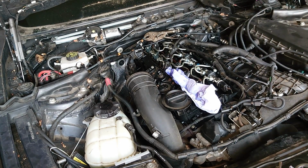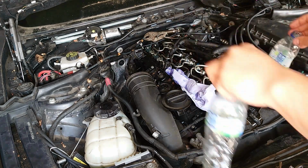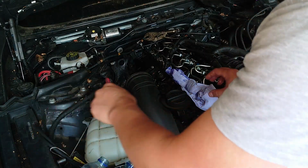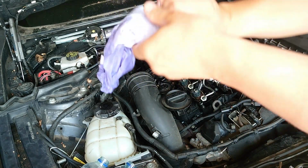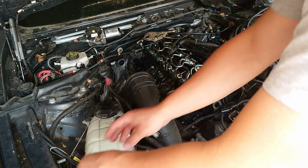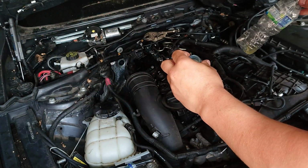So the thing is, in here we got these bottles, and they all look the same, okay? And number 2 and number 3 look the same as well. The only thing quite strange in here is that, like you see, number 1 doesn't inject much fuel out, and I think that's the way it should be, because this is a big engine. With all the injectors leaving fuel like that, you will never gain pressure on a rail, yeah? Never.